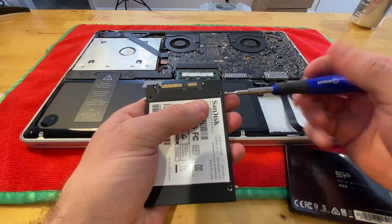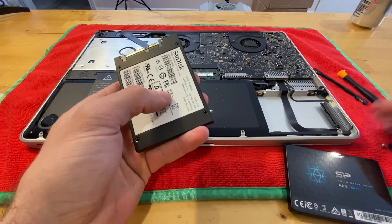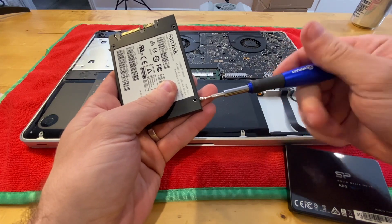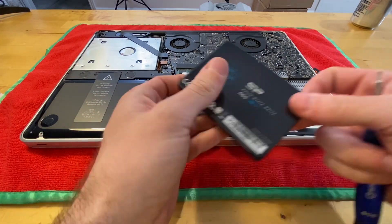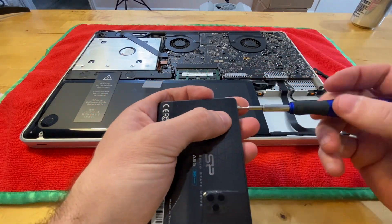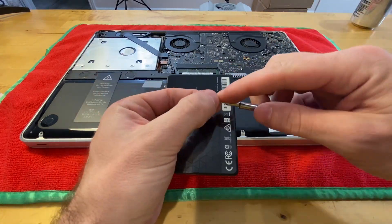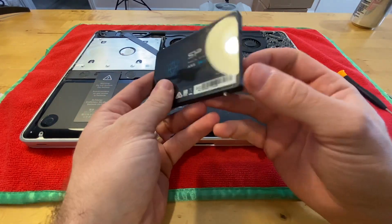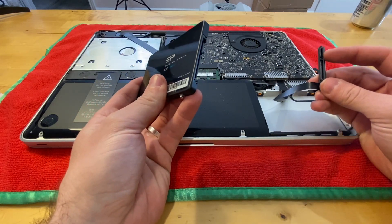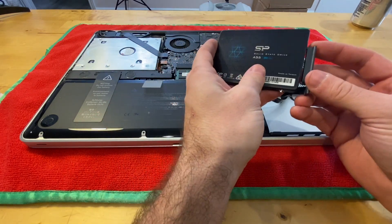You'll remove all four of these little side screws — they are a T6 Torx bit — and replace them on your new drive. When reconnecting, make sure you line up the connectors: this is your data, this is your power. Same thing on the new solid state drive.